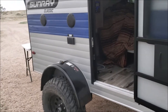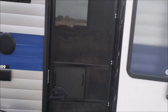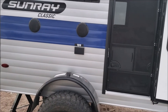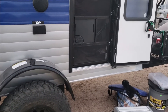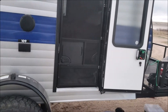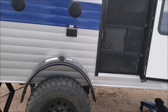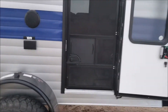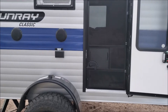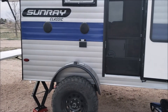So far, this is the first trip with this trailer and it's been awesome. There's also a screen door that you can place in there as well. Initially when I first got it last week, I did have some issues — more of a manufacturing issue. I was filling up the water reservoir and it was leaking everywhere. Come to find that the connection from the water reservoir to the water pump was loose and was literally just spilling out at that connection. I also found that one corner of the water pump was not secured down, which was allowing it to vibrate pretty badly. I fixed those things on my own — didn't take a whole lot to do — and I haven't had any other issues beyond that. That was just a manufacturing issue.